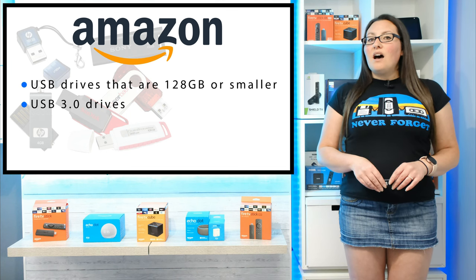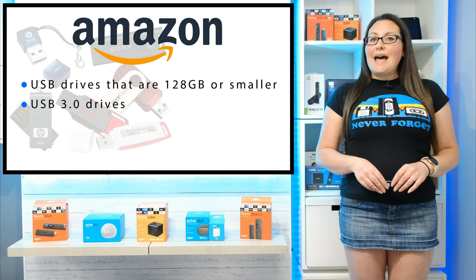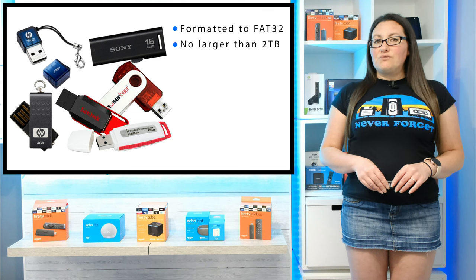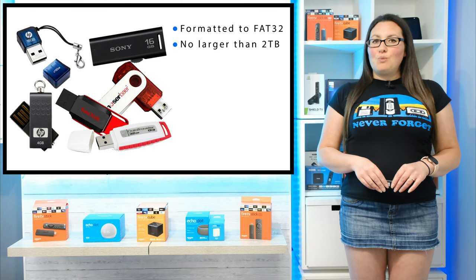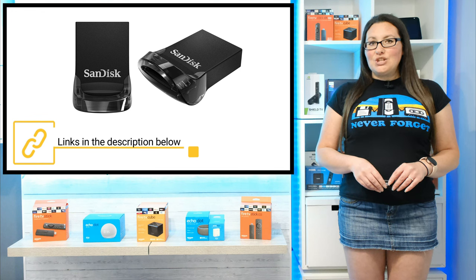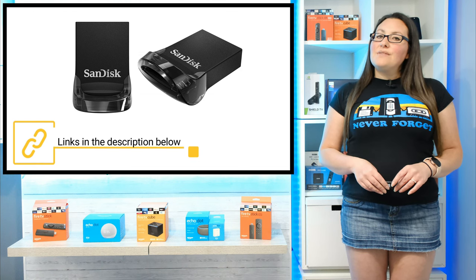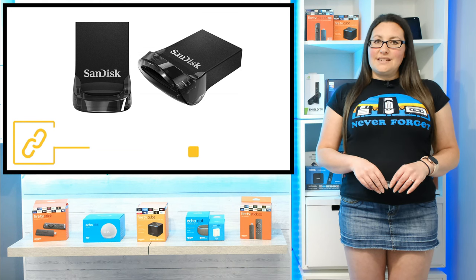However, Amazon officially recommends using USB drives that are 128 GB or smaller. Amazon also recommends that high-speed USB 3.0 drives are used, even though Firesticks have a USB 2.0 port. This is because USB 3.0 drives tend to have faster read-write speeds and will perform better even when connected to USB 2.0 ports. Check the links in the description below for my recommendations of which storage to use. I always prefer to use a SanDisk branded flash drive, and I have yet to experience any issues using this brand with any of my Firesticks.